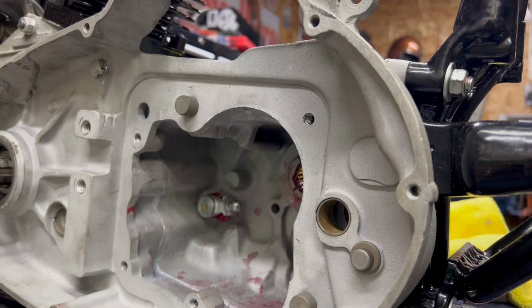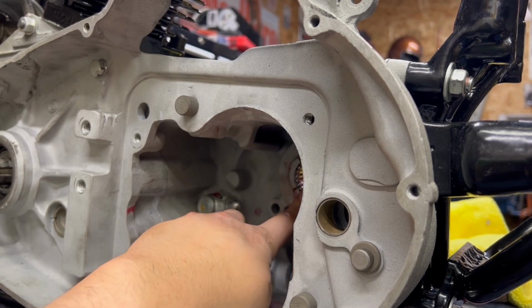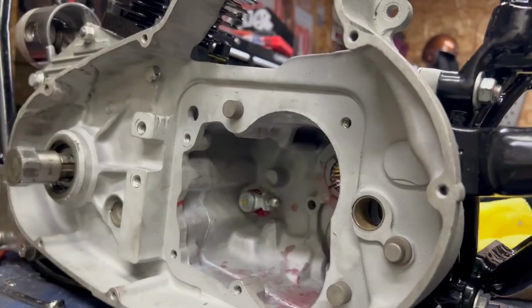And I will then, like I said, run in, eat some dinner. Then all we've got to do is come out, drop the transmission back in here, line up the shifter rod, so that's got to get pressed into the case, through the trans on the trapdoor, and then we've got 4 bolts to button up this transmission.